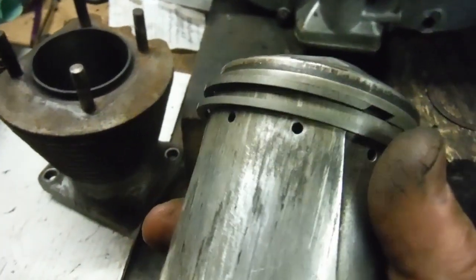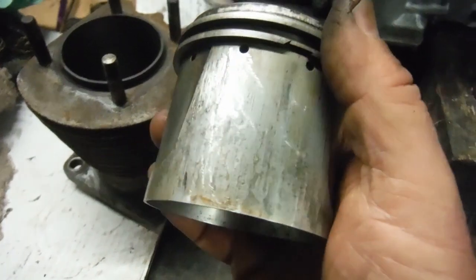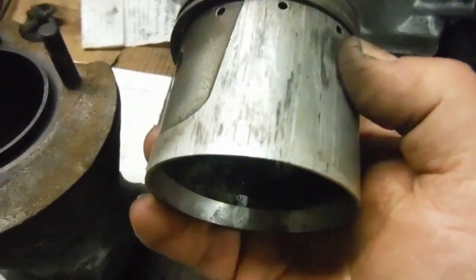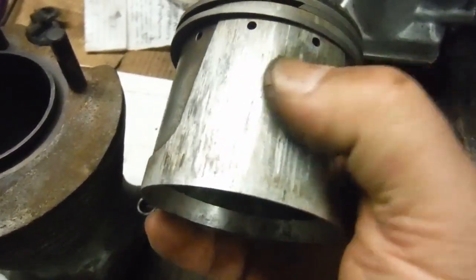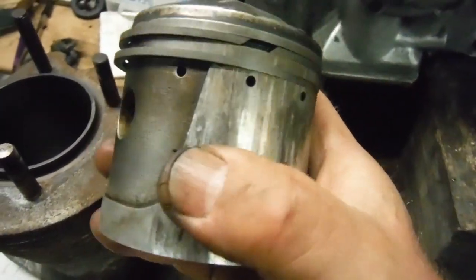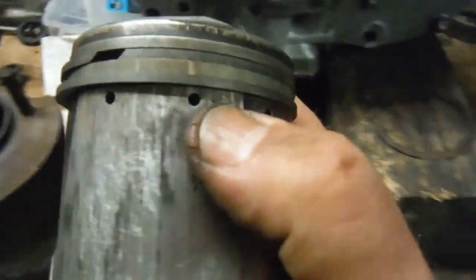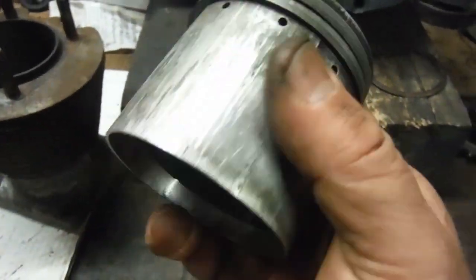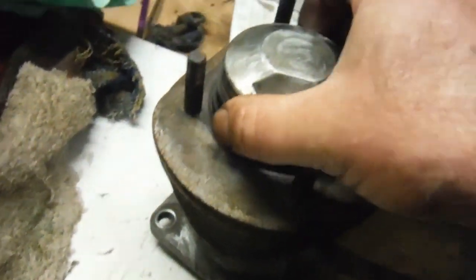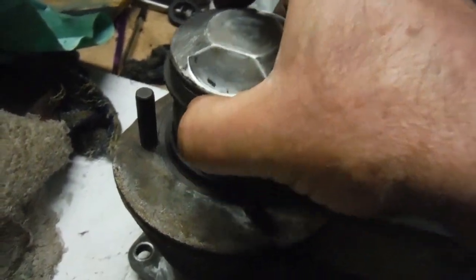At some time in the past there has been a tightening up of this engine. I've cleaned that up carefully — you basically just gently go over it crossways, not up and down, with a very fine flat file. Never use emery, just in case there's any material that actually got stuck to the piston when it tightened up. That's all you want to do — you're not worrying about low spots or making it look like new again. The fit of the piston in the bore is good, certainly not overly loose.